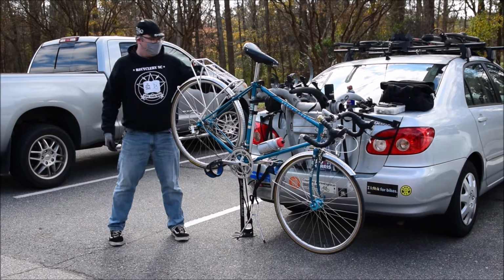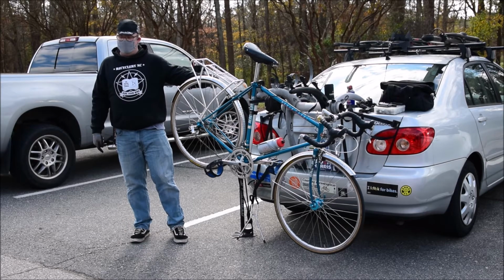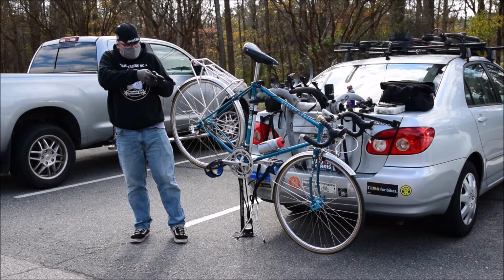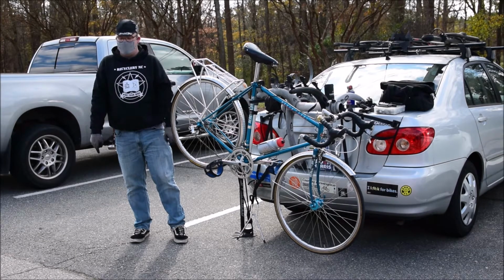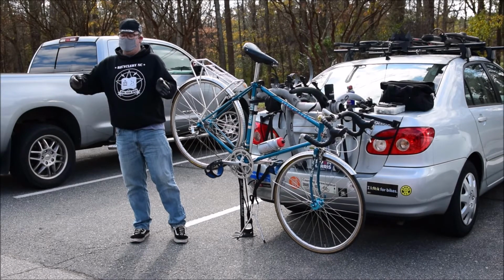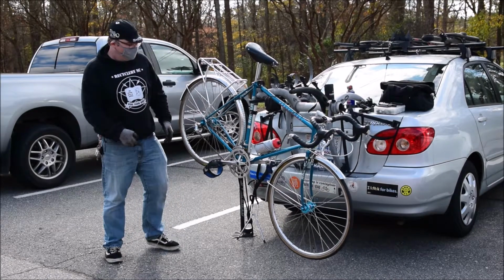So your shifter usually has what's known as a little half click, where it has a little bit of give. That's your trim. That's basically to move the derailleur just enough, and you'll have to feel this out depending on what type of bike you have. But it'll move it just enough to where it won't shift it onto the big ring, but it'll keep it from rubbing.